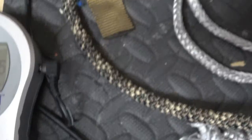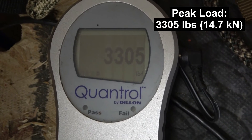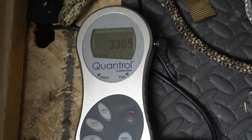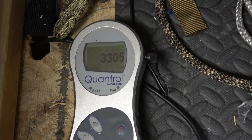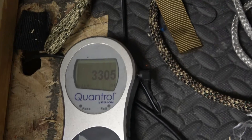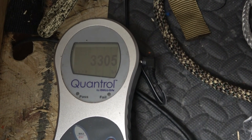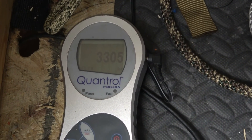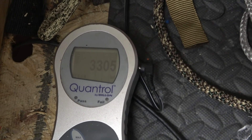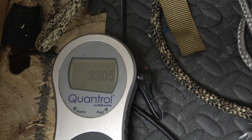Let's pan on over. So this time, 3,305 pounds — we got greater holding power. Now this is a fairly small set of samples, just two samples, one against each other. We'd have to repeat this test to draw any significant conclusions, but it definitely is making me confident in the recommendation of either of these hitches as a backup.